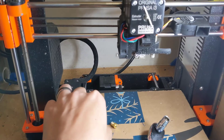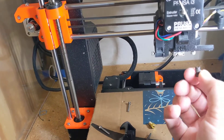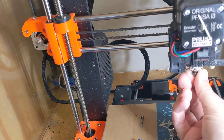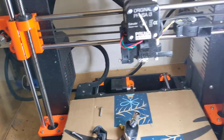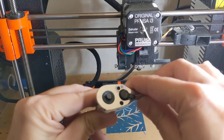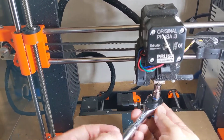We're going to go ahead and place the new Nozzle X back in — it's a darkened color because it's a hardened steel nozzle with a coating on it. You've got about five or ten seconds to place it. You're going to want to go what appears to be loose because you're going upside down — right up into the hot end like that. You've got about five to ten seconds before this will heat up enough to burn your hand. That's enough to get it almost finger-tight. Now we're going to reverse our socket wrench so that it engages when going clockwise and snaps when we go counterclockwise. When we turn it upside down, it's going to look like we're going loose, but relative to the nozzle, it's tightening it.